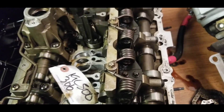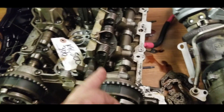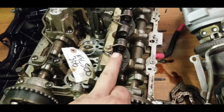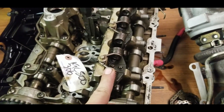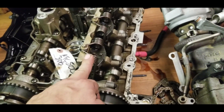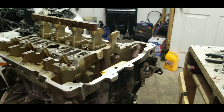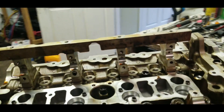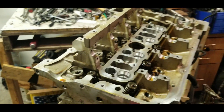It's not actually required to remove the camshafts, but these springs are very hard to deal with without the tools. You can remove the springs but without the special tool you cannot install them back. On this engine I just removed them because we already have our other head and we need to replace the camshafts too. When I start installing everything back you will see how to do that.